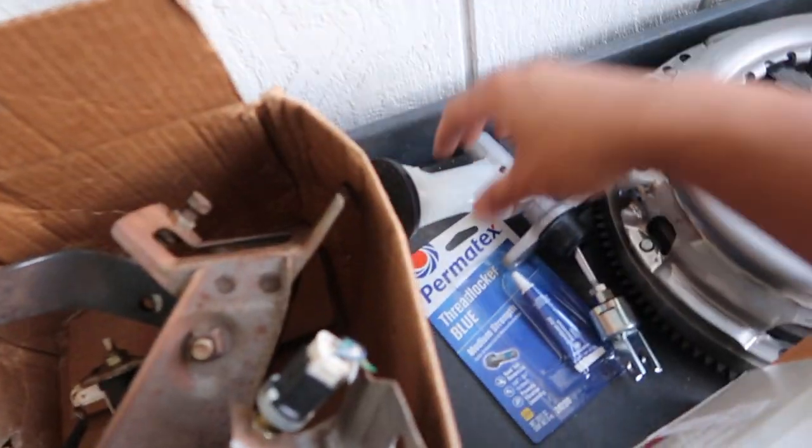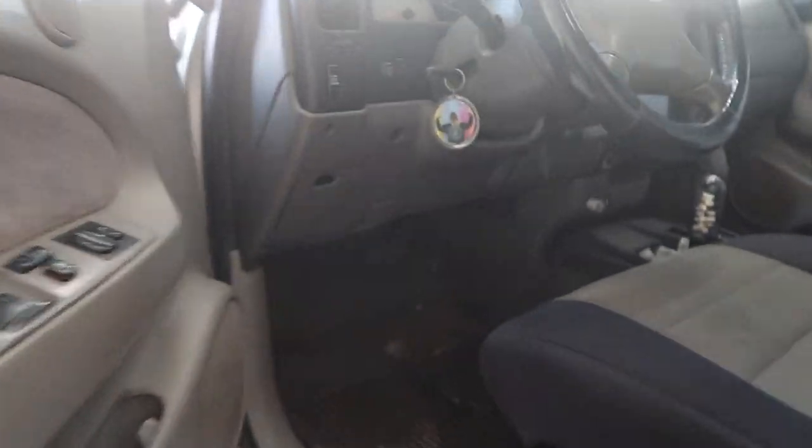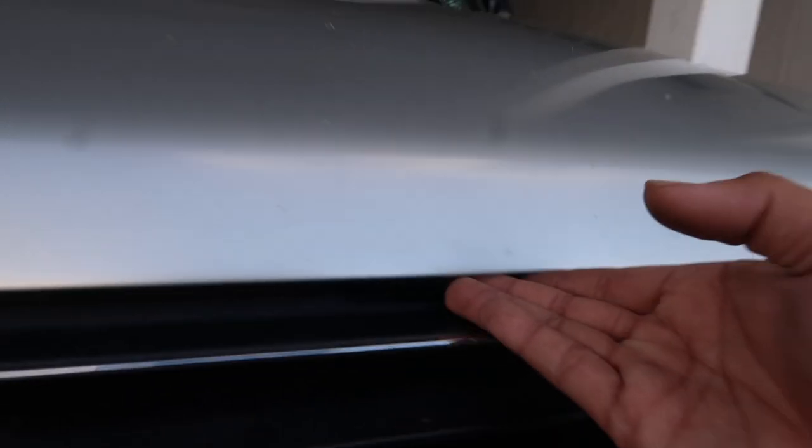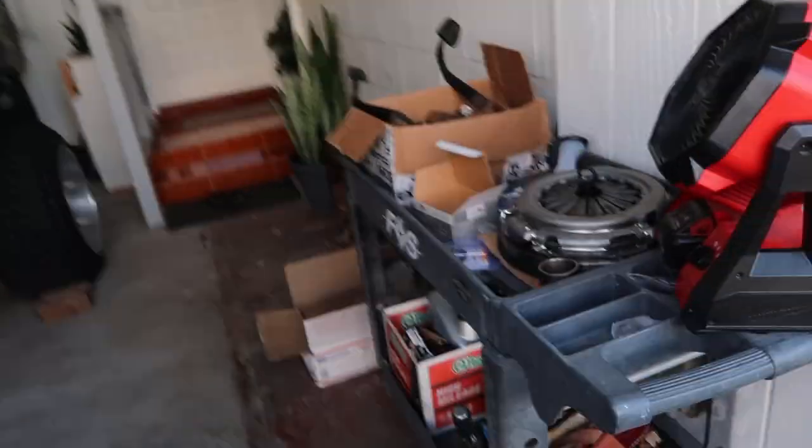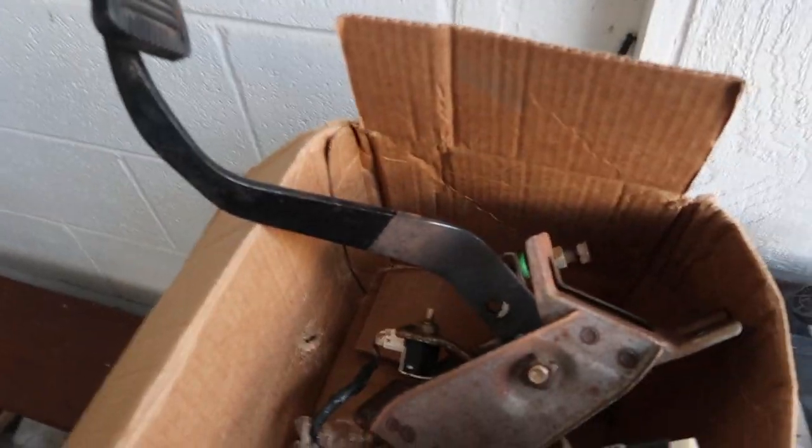It's Saturday morning, about seven o'clock. No hat today because we are gonna get down and dirty. We're gonna try and get the transmission swap done today, and I'm gonna divide this video into two parts. Part one will be putting up the clutch pedal and master cylinder, which involves cutting down here or drilling it because of how the master cylinder rod connects to the clutch pedal, so the general area is gonna come up from somewhere over there.